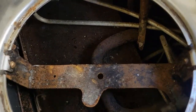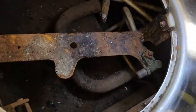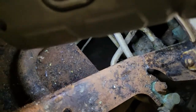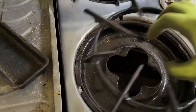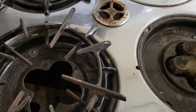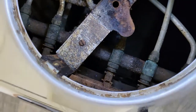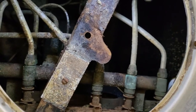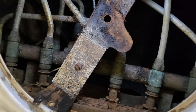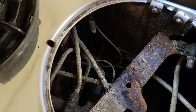What we see is it's really dirty and a little rusty, but the flash tube is there — may or may not be fully intact. We see the gas lines are in there. You can look in to see the valves and the thermostat. Look under the front right burner as well — this is where you find the serial number plate. All the gas valves have some corrosion on them, but these are brass — that's surface corrosion, nothing to be too concerned about. The gas lines don't look bent, the jets are all in place, and we can see flash tubes hanging down — they probably jiggled loose during transport.